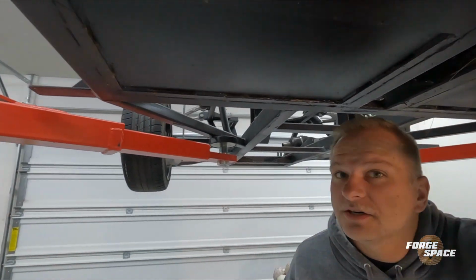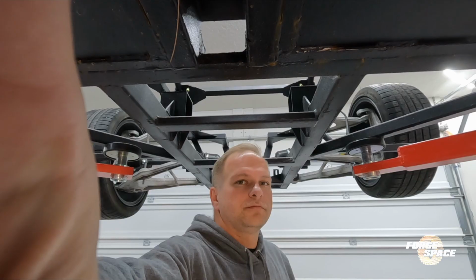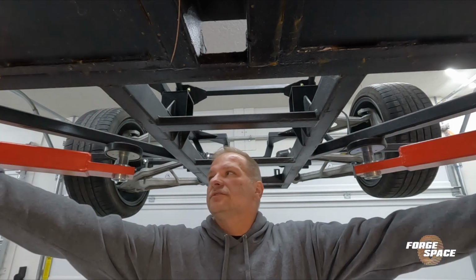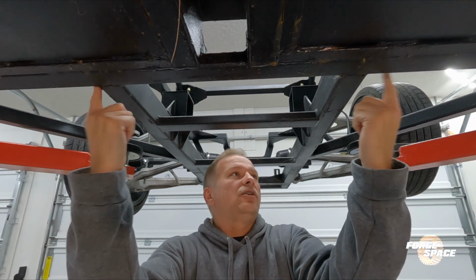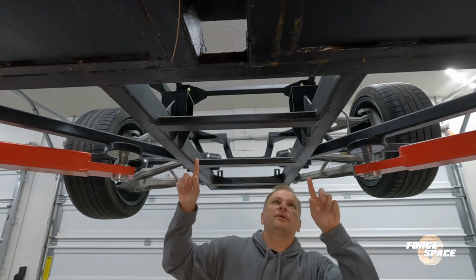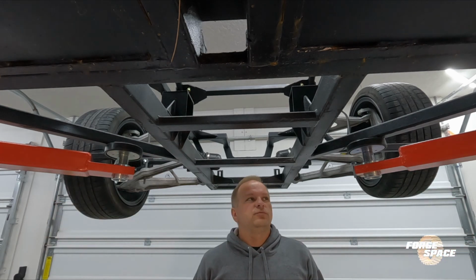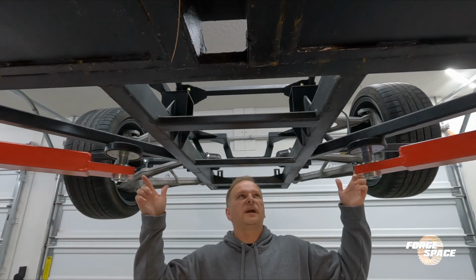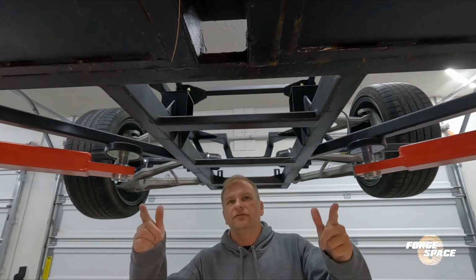Take you guys back here. Oh, spider webs. After the floor pans are done, back here, this entire portion needs to extend out back more. So what we're going to do is cut out this entire rail portion to right about right here, and then remove all this, and then we should have room to get our battery in, and then we can work building back the frame after the battery's in here. So go ahead and do that, start with the pans, and then work our way back here.